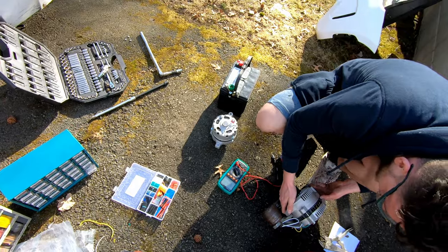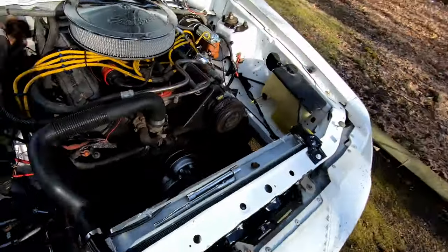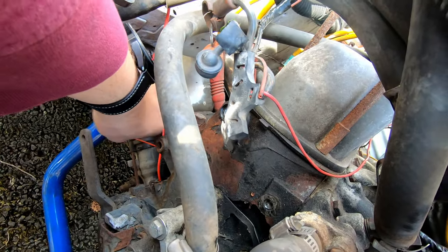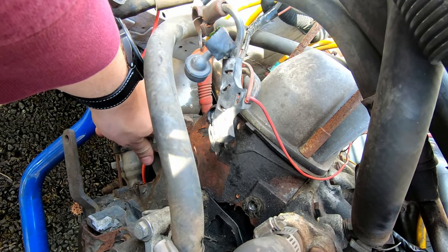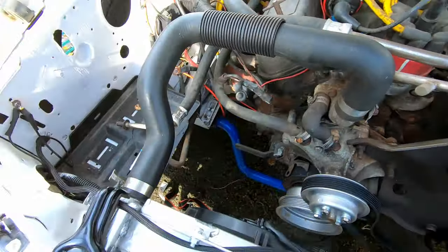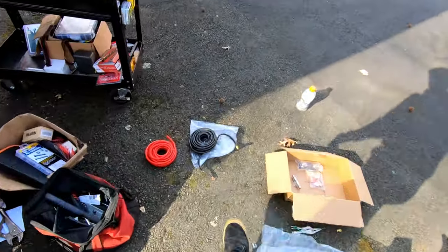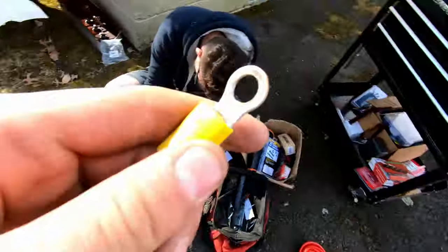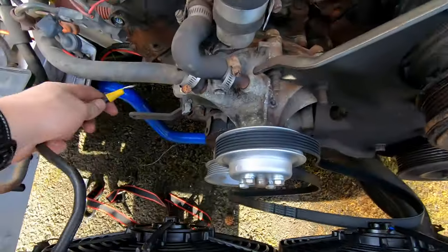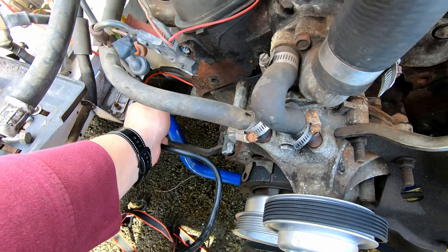So now I'm wondering if I could just run a wire to this exact grounding location where the battery is also grounded from the alternator. Then we wouldn't need a long wire at all. Because where the battery one mounts, we could definitely squeeze another one in there. Okay, go for it. A ground. So whatever you think is good. I mean, the ground is ground. All right. So you can have this on here as well as the alternator one. Yeah, that should work. Yeah, we could definitely do that.